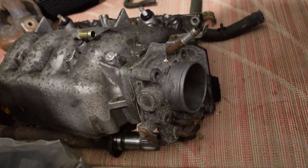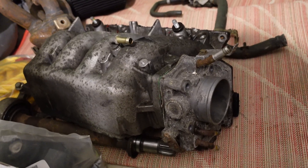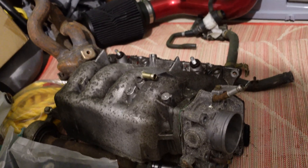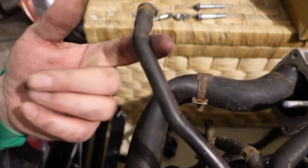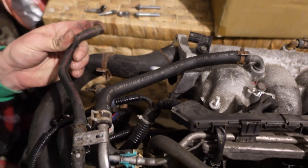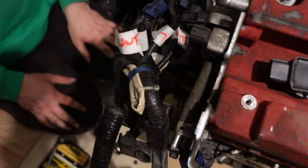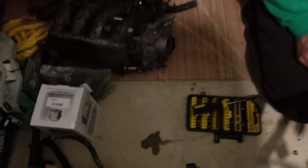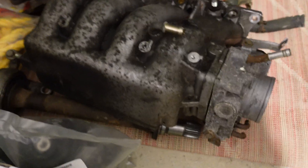We could make it work without any adapter, possibly. Because all we could do is take a chunk out of the bottom of the manifold with the grinder — that would work. It's just mainly for flow and then make sure there's no air leak. That there is off the active charcoal, which would be on the throttle body — we'll just cut it off on the taper, switch it off, don't need it. So we've nearly got the loom off and nearly taped everything up. That was interesting to see how close it actually is — I thought it was going to be miles off from what I'd read on the net, but turns out it's not that bad. It's an easy modification, actually.